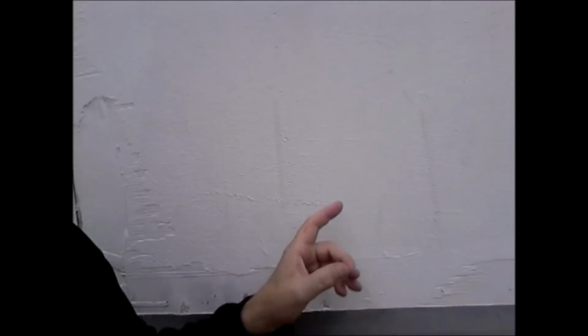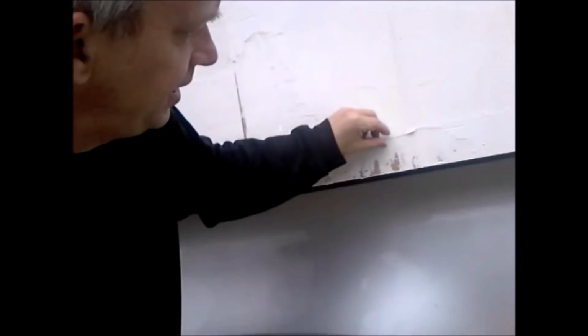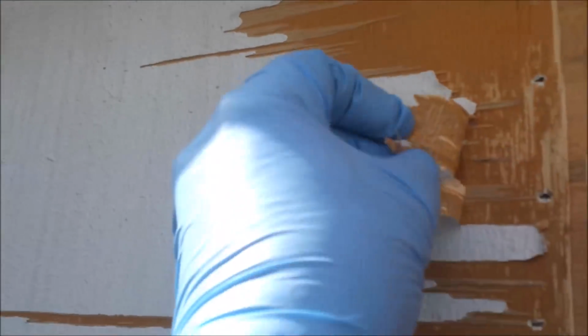Well, some of these little holes actually became big enough where, I guess, when it got cold, that 2 degree weather sucked moisture in. There was a hot side on the inside and the cold side on the outside, which sucked moisture in. And as soon as it did, it delaminated the paint. See? It delaminated the paint right from the Luan. Just pulled it right up. And so we had all these bubble spots all over the camper.